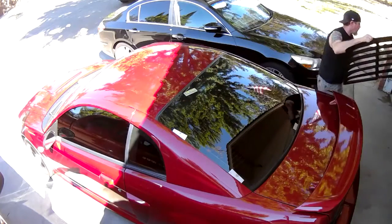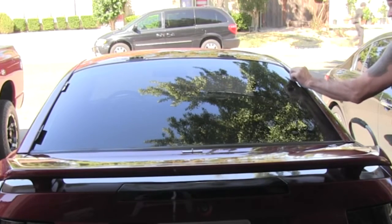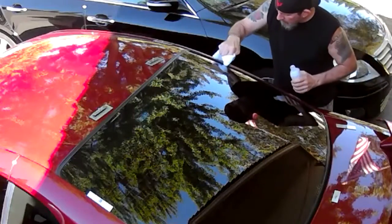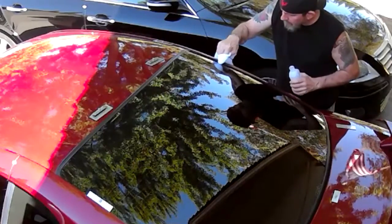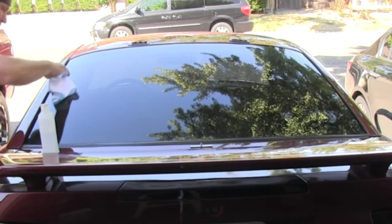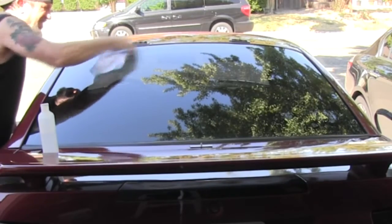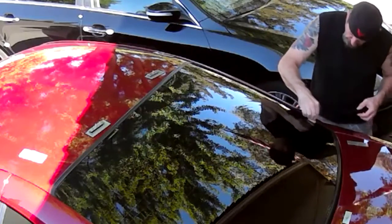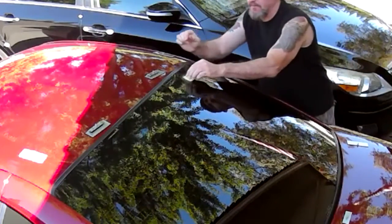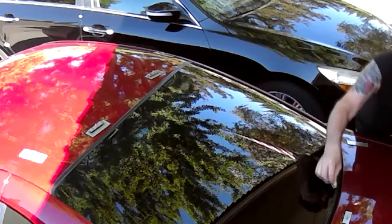Just take the louver off now and get the brackets put up out of your way. Take some rubbing alcohol and clean where those brackets are going to be, making sure that I don't wipe off my wax marks. Then I'm going to take the adhesive promoter pad and wipe that adhesive promoter where all the brackets are going to go, again making sure that I don't wipe off my wax marks from my wax crayon.